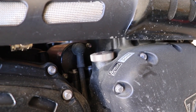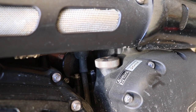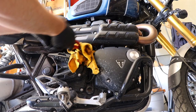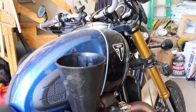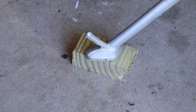Our next step is to actually put new oil in the crankcase. You can use a rather large hex head with an extension to come down through the top, but this is very tight from the factory if this is the first time you're doing it. What I like to do is just use a pair of channel locks with a rag wrapped around it to prevent damage to the oil fill. Be careful because if the engine's hot this area gets very hot — it's right next to the header pipes. Once you get the plug out, use a funnel and come down through just like this. In order to get the bike level and put the correct amount of oil in via the sight glass, you have to have the bike somewhat level. So instead of having somebody sit on it, I take a 2x4 and stick it underneath the kickstand, which will get me pretty close to line up with what the sight glass is going to want.